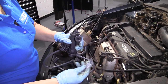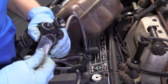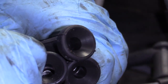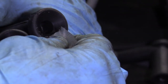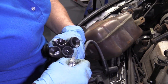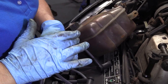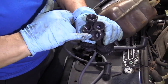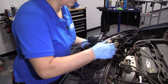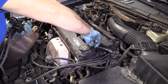So here we have our new plug wires and it comes with a little silicone gel pack. About 90% of wires do. I'm going to put a little bit at each tip where the spark plugs meet, on all four wires. I want it to be on the contact, inside the cylinder hole. So the shortest one — I'm going to say that's going to be the closest cylinder, which is cylinder four — I'm going to pop that right down until I hear it click.